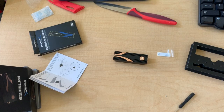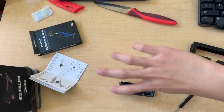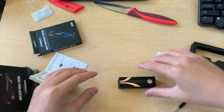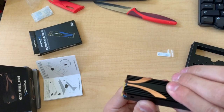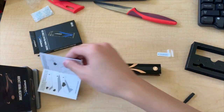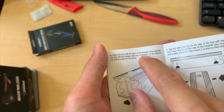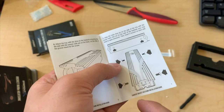Is it aligned? Yes it is — at least I hope it is. Now it says peel the clear thermal protector off of the other side, then lower it onto the SSD, wait until the screw holes match — and yes they do. That's what the instructions say: attach, allow movement for the screw, align the holes — yes, okay.